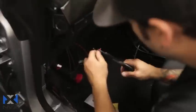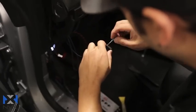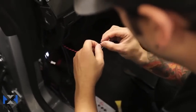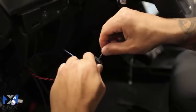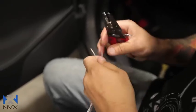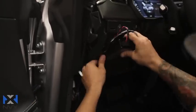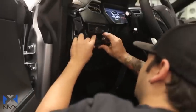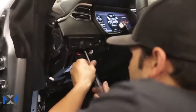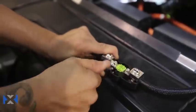Now that you've gotten a closer look at the different wire configurations you'd tie into for signal for your LC2i, I want to make note that it's always 100% necessary to test the wires you're tying into before you actually do it — just in case the manufacturer makes changes. So far I haven't seen any changes in wire colors on the Teslas I've done, but that doesn't mean they won't ever change them. It's always a good idea to verify the wires you're tying into for signal before you actually do it.